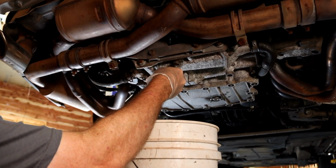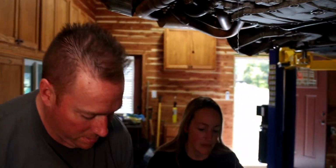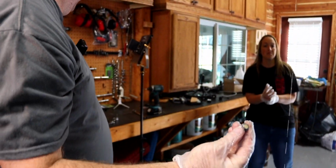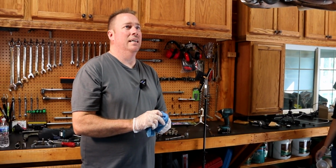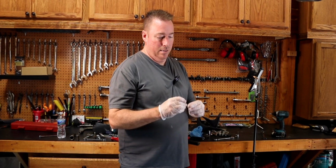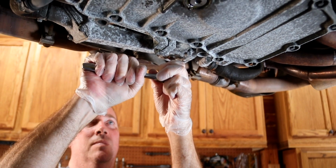All right, so we're just going to pull this drain plug out for the coolant. Straight water. There's a little drain plug. It does have a little bit of milky oil or something on the end of it. Yep. So I don't know. There's no coolant in it, so there is that. Hard telling. It does have straight water in it. Keep in mind, it does freeze in Biloxi, Mississippi, where we got this. Straight water is never a good idea, no matter where you live, unless you live in like Hawaii, where there's zero chance of it freezing. Even if you don't have an issue with freezing, if you sell it to somebody or somebody borrows your car and drives it just a little bit north, then it's going to freeze and lock up. Retorque this, even though we're more than likely going to change the crush washers on them.